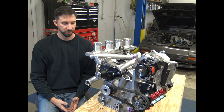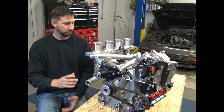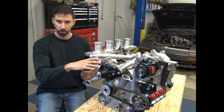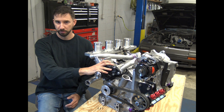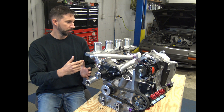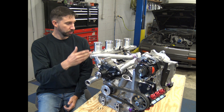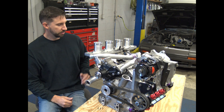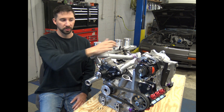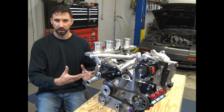Even the front housing actually incorporated a dry sump belt driven by chain. So the race Mazda four-rotors are something that everybody would dream of having but nobody really can own. I've always strived to emulate their technologies into production-based motors like this. So when you build a four-rotor from me or anywhere else, you're dealing with some 13B production parts, and then we're adapting or custom machining them with tight tolerances and experimental work to bring you a four-rotor.